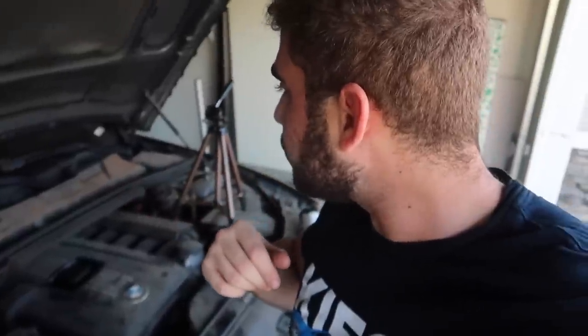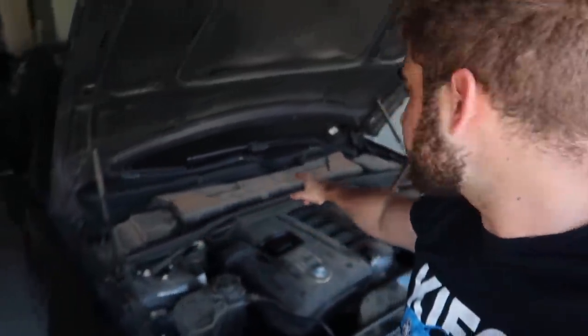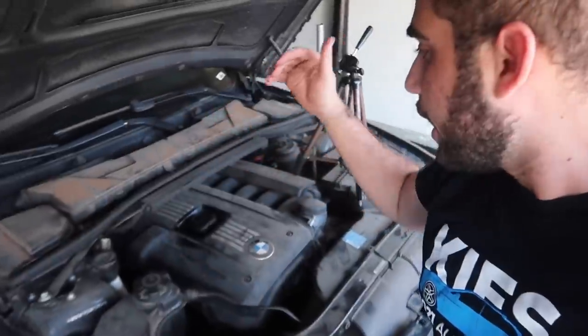Now that we've pretty much finished up the oil change, the next thing we're going to have to do is get all those cowl pieces off. We need to remove this cover right here to do the ignition coils and the spark plugs. I want to make sure the spark plugs aren't drenched with oil. If I see oil in any of the cylinders, I'm not going to replace the spark plugs — I want to do the valve cover first before doing the spark plugs, just so we don't have to ruin the new NGK spark plugs.